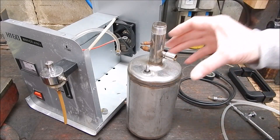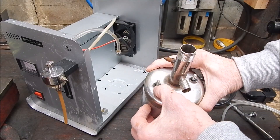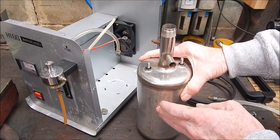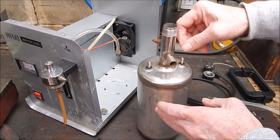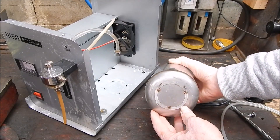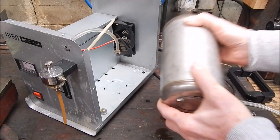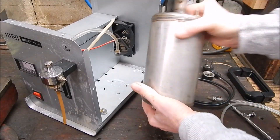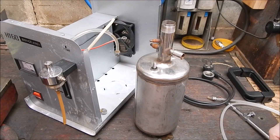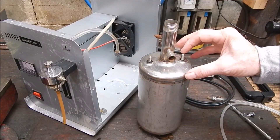What's interesting is that you can see there's just two terminals that come through the tank in a rubber grommet, and I've tried beating down on them — couldn't move them. I've tried lock nuts, trying to unscrew them — they don't unscrew. On the bottom there's just some tabs that lock it in place. But listen to this — whatever's in there is floating around, which isn't a good sign. I'd say it's probably separated from these terminals, which is quite possible.